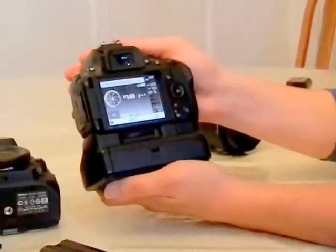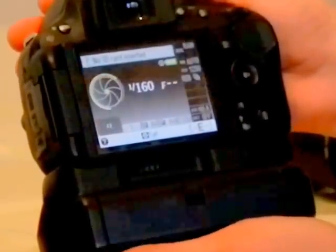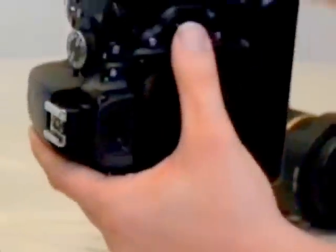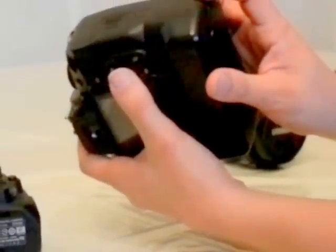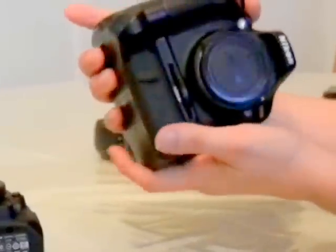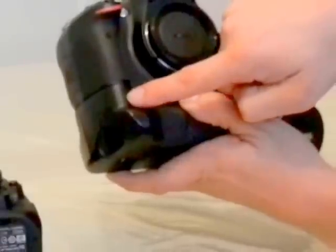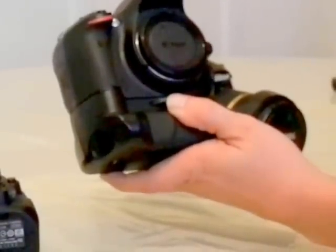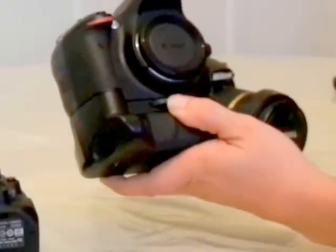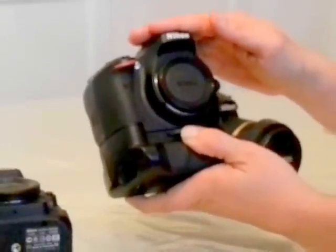Now we have the almost assembled battery pack of the 5100. The problem is that there's no intelligent communication between the bottom and the body of the camera itself. The way that you would trigger, if you're shooting vertically, you have the button here — it's not going to do anything. There are two different types of battery packs. One of them will have a little infrared transmitter here that sends out the signal like your ML11 remote control will. The problem with that is you have to have the camera in remote mode in order for that to work.